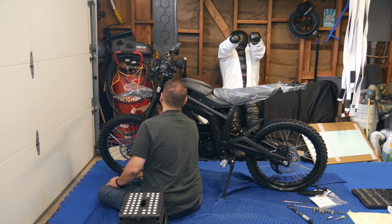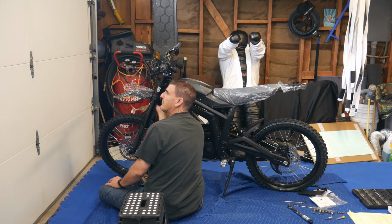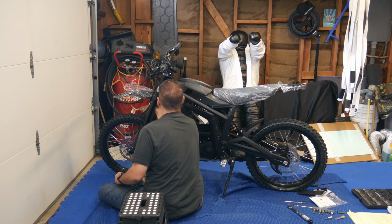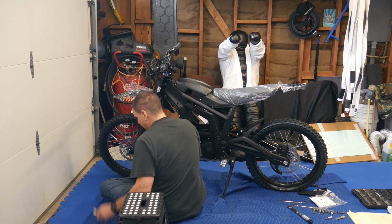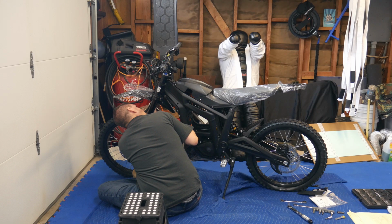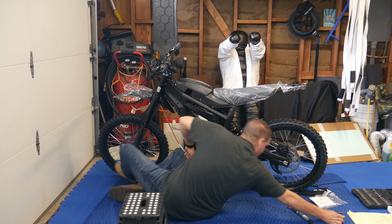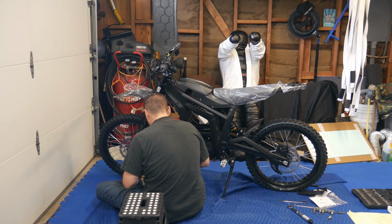And you don't have to worry about aligning the fender. It'll just go right on because there's 3 holes here and they're in the shape of a triangle. So pretty much the front 2 will line the fender up. There's 1 in the back and 2 in the front. I don't know how many newton meters the fender is, but I think the guy's name was Chris. He did say to snug it on there pretty good because it could get loose. But don't go too crazy because these are cap screws and you could strip these. And you might need an extension, the extension that you use to put your front axle on or take off your front axle.